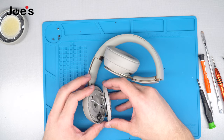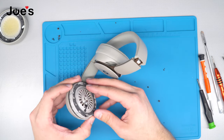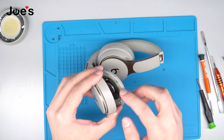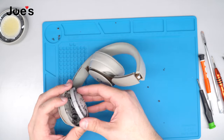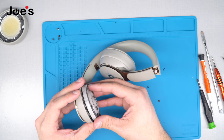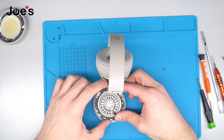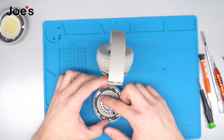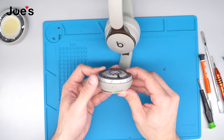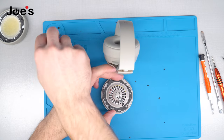Once we have done that, the next step is to close the speaker back over the cup. You want to make sure that where the screws go, they line up with all four pins. Go ahead and place it over. Inspect it — make sure that you don't see the speaker wire in any of the holes. Check the sides, make sure nothing is pinched. Once you've confirmed that, go ahead and put the four screws back in.